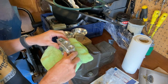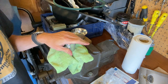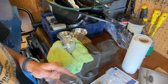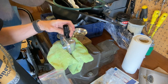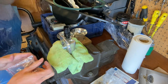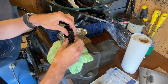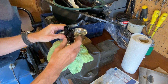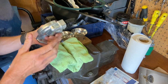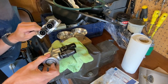The AN10 fittings are all in - makes it quite a beast. Now we're doing the filter mount - I'll get this in the vice and wind these two in. It's exactly the same procedure. The filter mount fittings don't go in quite as far as they did on the thermostat. There we have it - filter mount finished. We now have inline oil thermostat and filter mount finished.